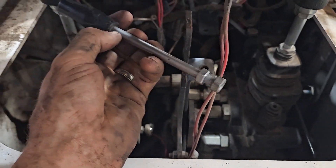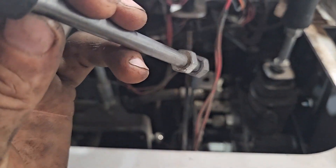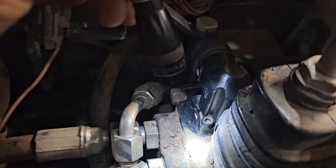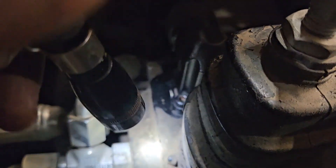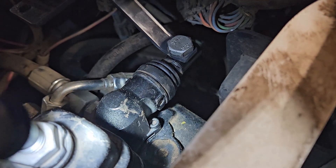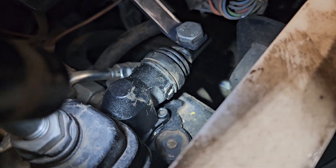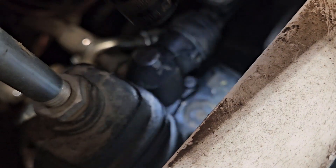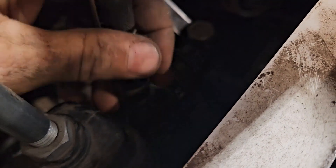When you take this off, it's just got a half-inch nut and a half-inch bolt screwed all the way into the threads. Then take off these Allen screws right there — they're 5/32" — and I only have two, one right there and one on the other side. Get those out with an Allen key; mine were quite loose. There is a rubber gasket down there, so be careful not to lose it.